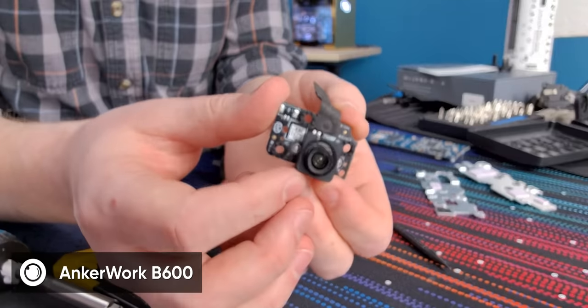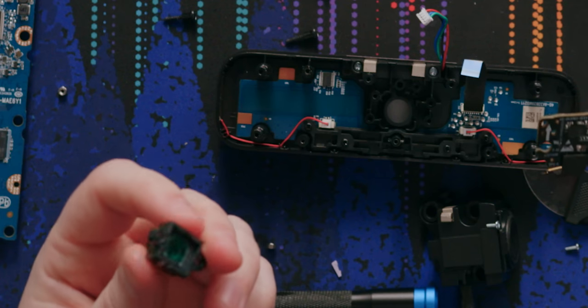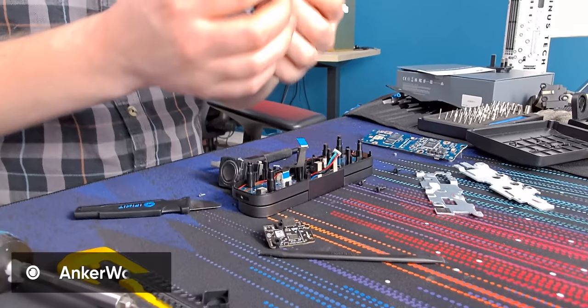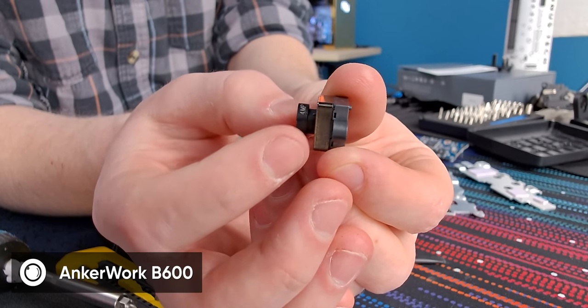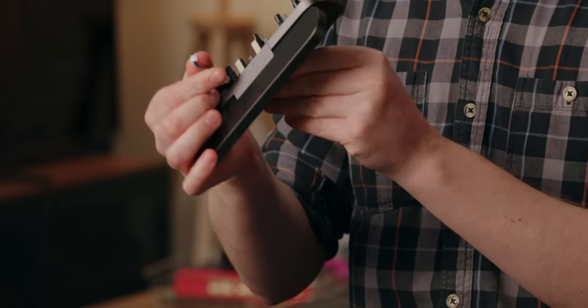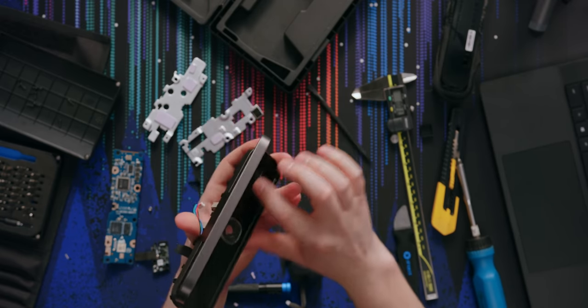There are the speakers. Now onto the star of the show — let's take a look at the sensor. Here's the camera module. I just broke the lens off — it seems like they attached it using just a couple of bits of solder. At the back here we have the IR filter. Every digital camera is an infrared camera — you just need to filter that out, otherwise everyone looks super weird. It seems like this is a voice coil; the autofocus is done by moving this in and out ever so slightly, done in a similar way to how a speaker works. And finally, we have the sensor — yeah, there it is. It's so little. This powers the light and the rest goes toward the touch controls on the sides and the front.